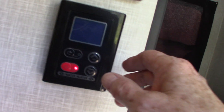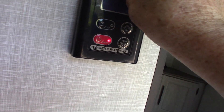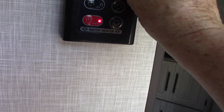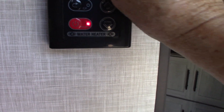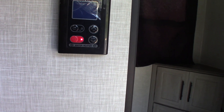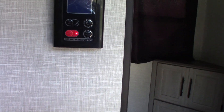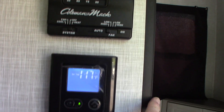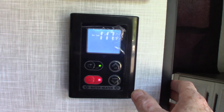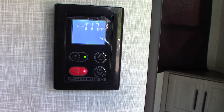This is your on-demand water heater. Basically, this won't operate unless water is demanded — either you have city water hooked up or your water pump is on and you have water in the tank. Then it'll turn on. It's set to 117 degrees. You can change it, but don't make it too hot obviously. Every time you turn on the hot water, it'll send you hot water.